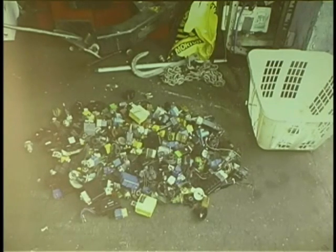I'm like, well, let me see what's going on. So I get over there, hook up my scan tool, and I'm just looking at stuff. I was looking at cranking RPM. When I cranked it, it attempted to start and died, and my scanner lost communication at the same time. I went, that's weird. So what happened was the PCM lost power from the relay, because when the coils went to fire, they drew down the circuit and drew the power away from the ECM.